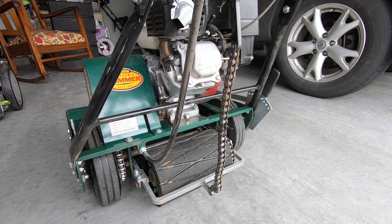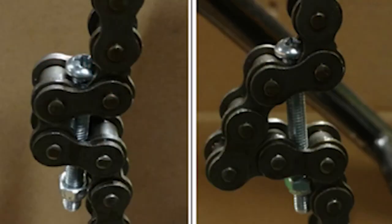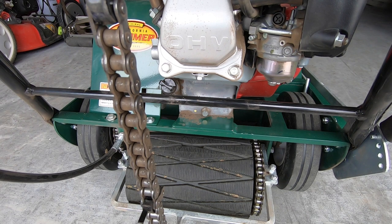That's how I came up with the zip tie. Here's option number two: you're just pulling links together on the backside. Do this with the chain slackened and the roller down, using a standard number 10 by one and a half inch or one and three quarter inch screw with a lock nut. Just put it through the link roller spaces to hold it in place. When you do this adjustment, you have to make sure that the drive roller still contacts the ground enough to provide the propulsion you need and not slip in place when in the lowered position — and the same objective applies if you're using the zip tie technique.